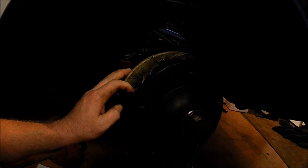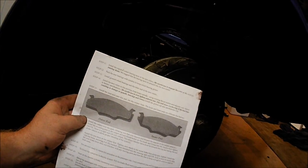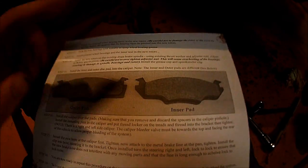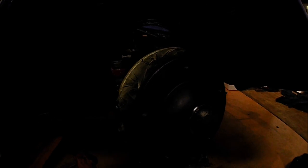I've got to come to a stop for the night and we'll continue tomorrow because I don't have any Loctite. I need Loctite to put the studs on for the brake calipers. I did paint the rotor — not really a necessity, just trying to keep it from rusting. The wheels will cover it up anyway. So far it's installing pretty good. There is a left and right caliper bracket, left and right caliper, and there is an inner and outer pad — the difference is the chevron shape versus the square shape. Read your directions. I'll go look for Loctite and call it quits. See y'all tomorrow.